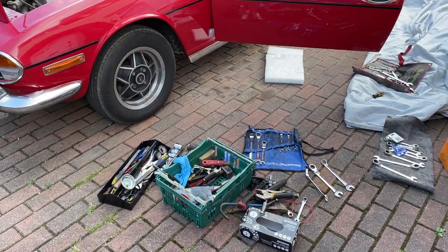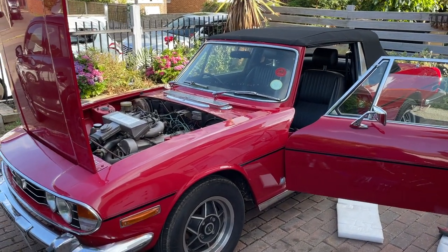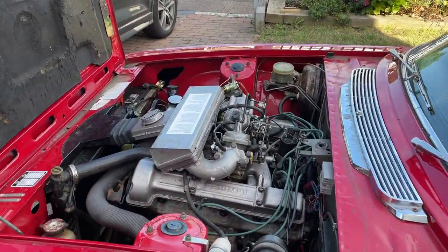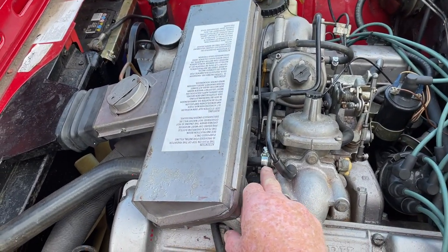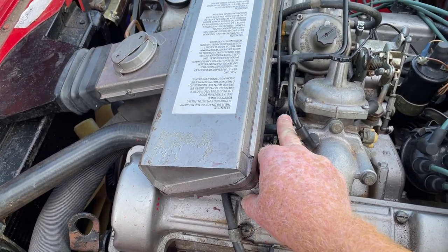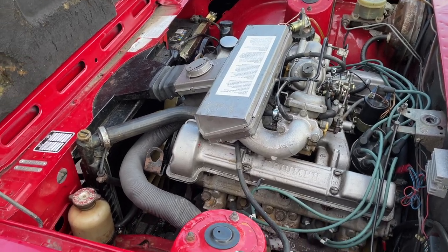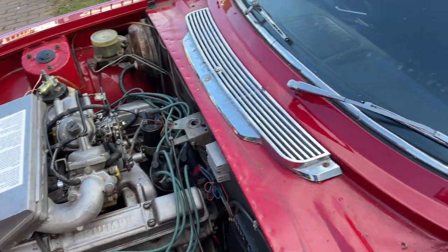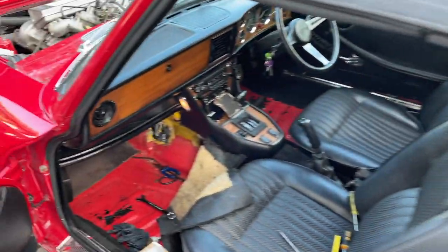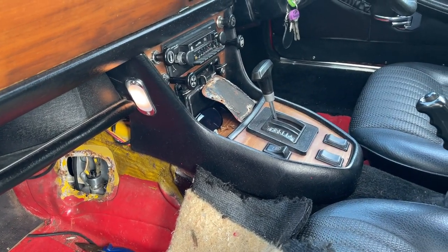Working on the driveway at a weekend - as you can see we have an almost exploded diagram of a Triumph Stag with the bonnet open and doors. There were some issues under the engine bay - I was concerned about these pipes here being just free. They are actually breather pipes, but I was concerned about them being loose, especially with a big journey next week. I've put some new jubilee clips on there, which should see us well for next week. It's all about being prepared for that journey up to Silverstone.